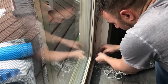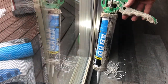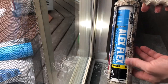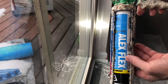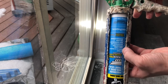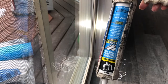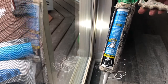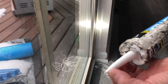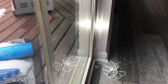What I picked up was Alex caulk. Do not use 100% silicone — that's made for bathrooms. This one is about a four-dollar Alex; they do make a two-dollar Alex. This one says Alex Flex. If this is your home, I recommend a better, more expensive one — the more expensive one has like a 60-year rating. Make sure it's paintable; if it's not paintable, it's not what you want to use. This one says 60 years from cracking. I put a little slit on it at about a 45-degree angle.